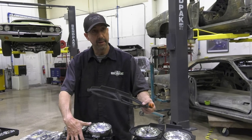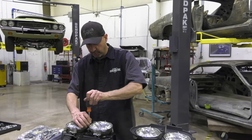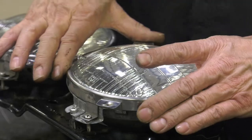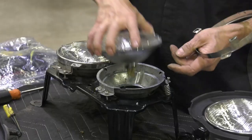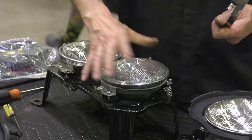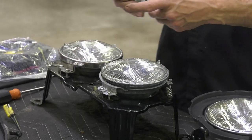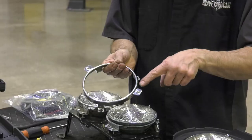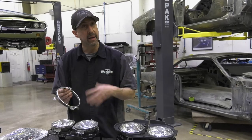That shield comes off, and now we're down to the headlights and the actual headlight assembly plate. These stainless steel rings around the headlight are the retainers that actually hold your headlight in. This retainer goes on and then it clocks — you turn it a little bit and they come off. Screws stay in place. That's how you change your light bulb. You unplug your clip from the wiring harness, and then your headlamp comes out. What's unique about this one is that shield actually screws to little tabs that are welded right onto this headlight retainer, making it unique to the '70 Dodge Coronet.